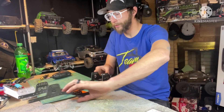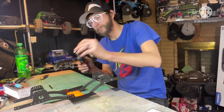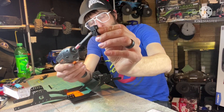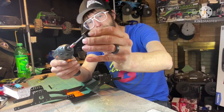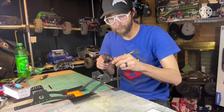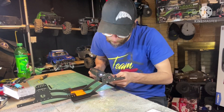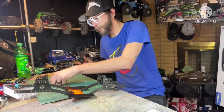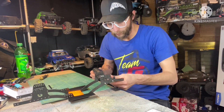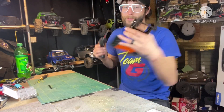Now you have three in, so you're ready for the last one. This is when you go ahead and get your panhard on. The multi-point panhard has three adjustables - they go down, starting there with that last spot. I'm going into that last mounting hole that attaches the servo, and then the front mount goes through the slot into the last drill spot.